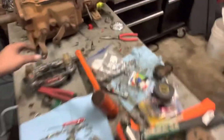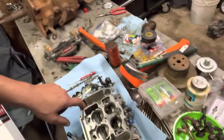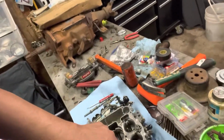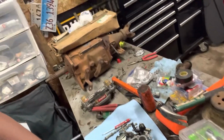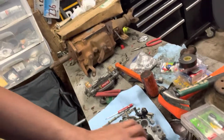However, here's the top. This is the gasket that's ripped. $55 for a rebuild for an Edelbrock. All I need at this juncture are, I'd like to replace these two booster pickups, and there's a gasket that goes in here. So I have one big flange gasket, 4 center gaskets, 5 gaskets, $55. No, not gonna happen.